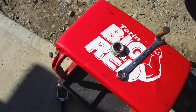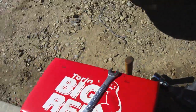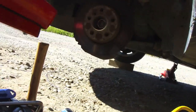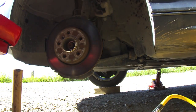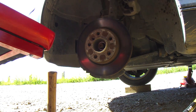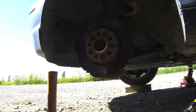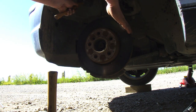The next step after you've got the caliper done is to remove this nut — it's a 36mm socket. Once that's done you can remove your disc. Move stuff out of the way and it should just come off with a rubber mallet.